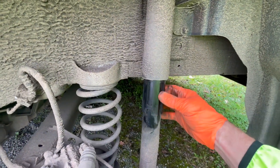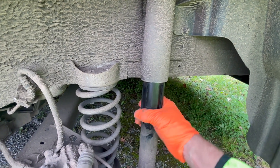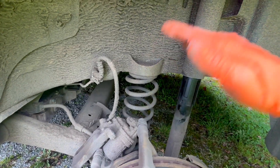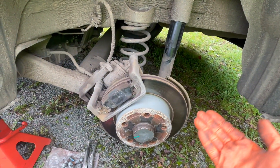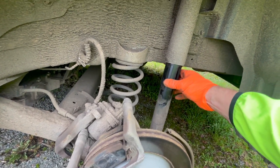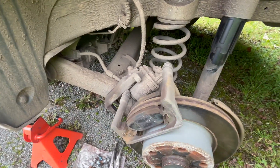This rear shock has definitely got some misting there, but nothing at a failing MOT level and I can't feel any difference. When a shock is gone, it stops dampening the spring's energy - the wheel starts jumping off the floor and you get a real impact on handling and braking. But I've not felt any of that. These are not expensive and very easy to change - two bolts, bolt there, out it comes. You can do it in situ because it's a solid rear beam, so the other side holds it in place.